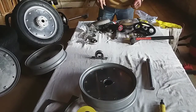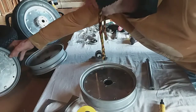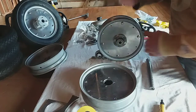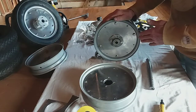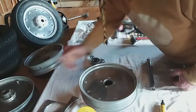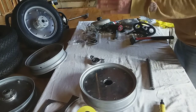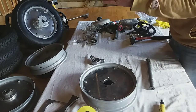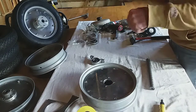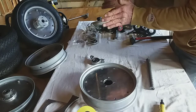On the front end of the car when I do this, because it would hit the chassis, I'm going to have to probably weld the front of the car because I'd like to put bigger wheels on the front as well as the back. Because on some of the dragsters I've done, as soon as you jack up the back with bigger wheels and the front's down, instead of the steering doing this, it's kind of trying to flap up and down and you'll get a bit of a situation where the steering's not so clever. So it's good to try and keep it horizontal.